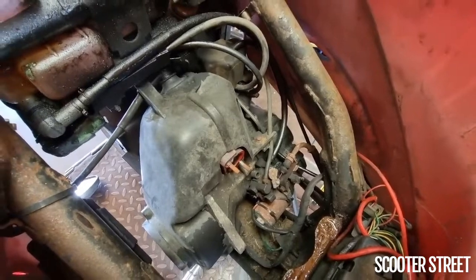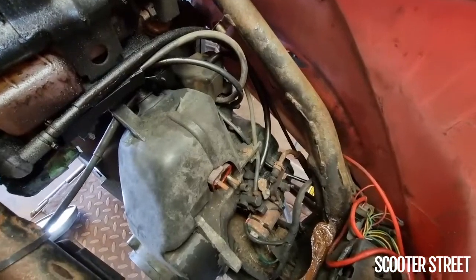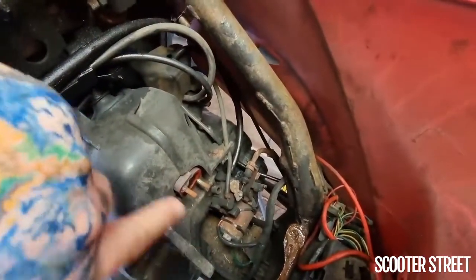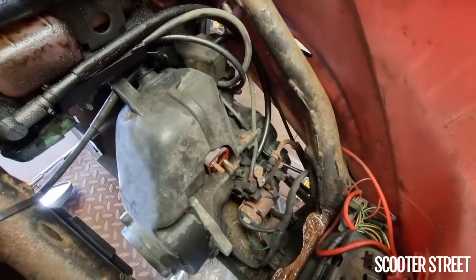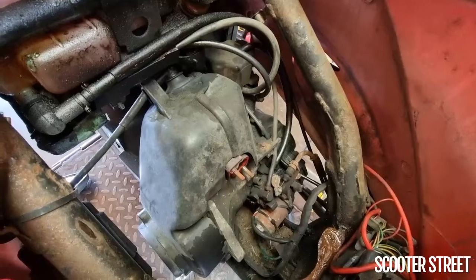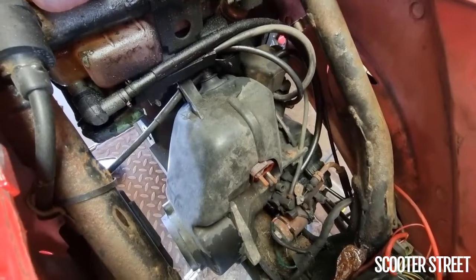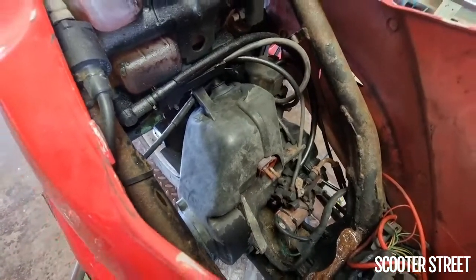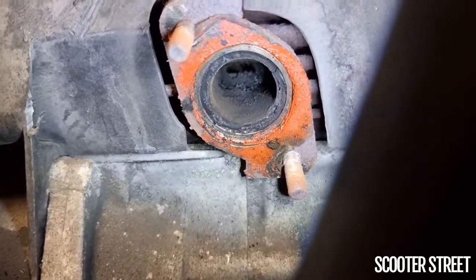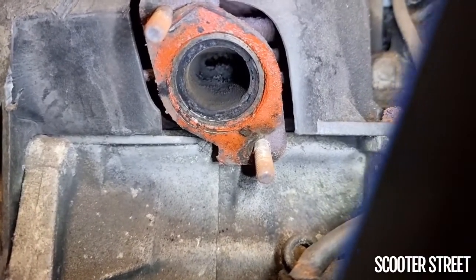I'll get the camera down with a light and show you how small this little exhaust port is. Fortunately on these, one of the small advantages of a vertical engine is it's quite easy to access the cylinder — you're not working around the chassis and the rest of the engine, you pop the seat out, and there you are. So it really is quite a small and quick job to clean that carbon out. You can sort of see that tiny, tiny little opening there that the exhaust gas is trying to get out of — it's probably one-third to one-quarter of the size of the actual opening.